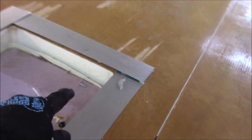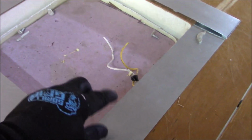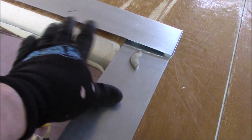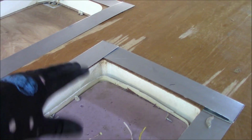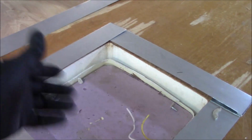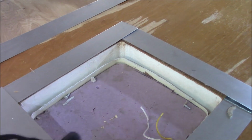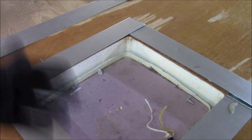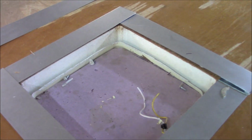And then what we did is, see, there's no stock in here. This is why these things leak. They expect, when they put that vent in there and they run the 28 screws all the way around, those little screws to bite into 1/8 inch. That's it. There's no framing, no stock. So now when the wind is hitting the vent and it's wobbling, of course they're going to loosen up. When they loosen up, then the caulking loosens up. You get water in it. Then you put some more on there, and once you put more on, then you got to do it again. You don't do it right, and that's the problem.